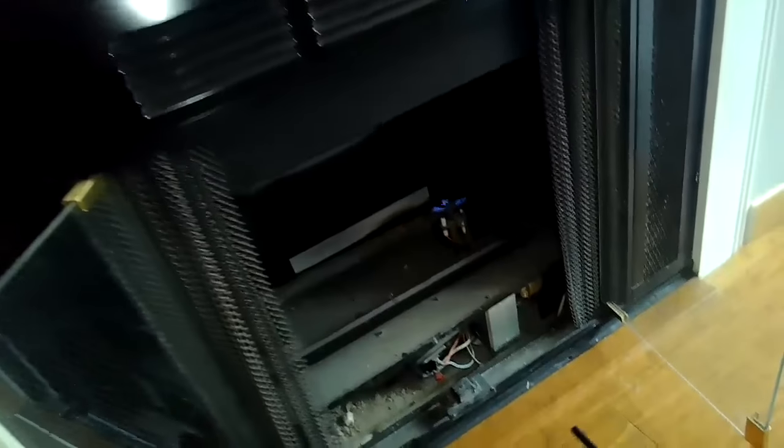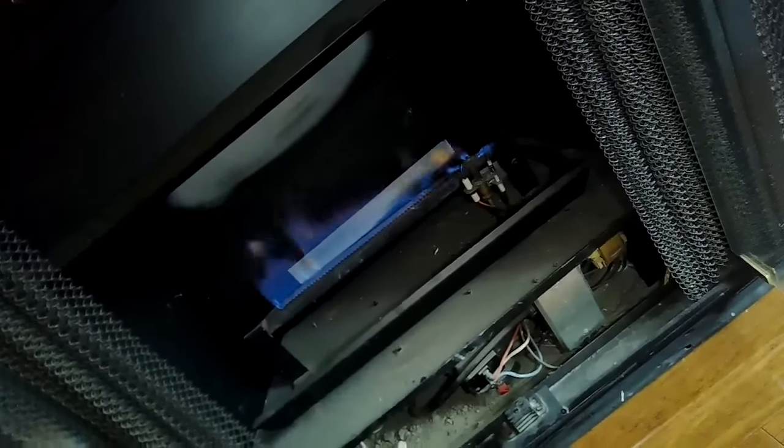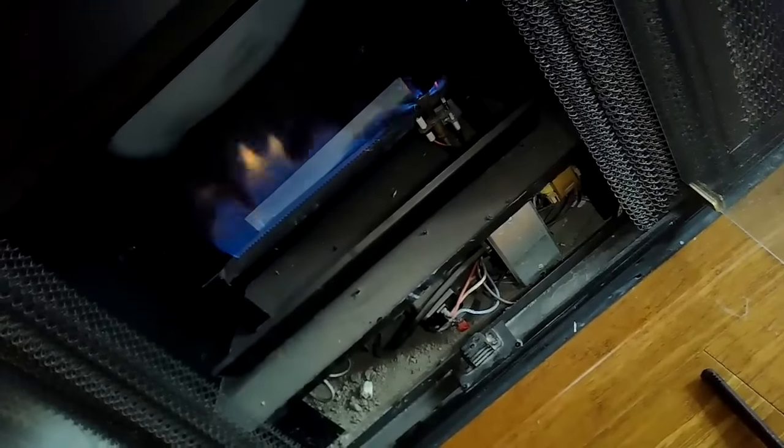I'm going to use an actual gas lighter to light it manually. That's what it looks like when it's fired up. Sometimes just lighting it manually will get it going where it'll then light by itself. While it's clicking, put a lighter or match there and it will light — that's showing there's gas flowing. When the thermocouple gets hot enough it'll let the main gas come in and then you get a big flame, so everything's working as it should.